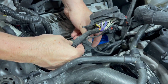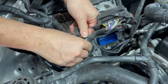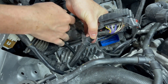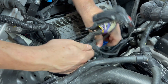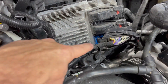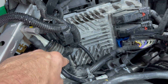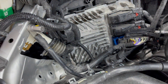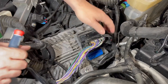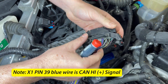These two connectors come from different directions on this car, so the two wires have to meet each other at our connector for the Reflex Plus. We're going to unwrap the harness all the way back to this joint right here — that will give us extra length once we pull those pins out to be able to get where we need to. We're going to start with the blue wire, which is pin 39, and that is our CAN bus high.